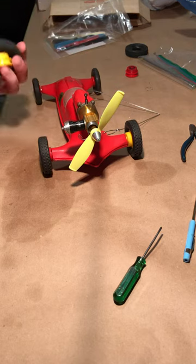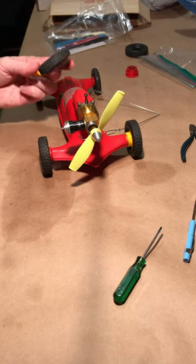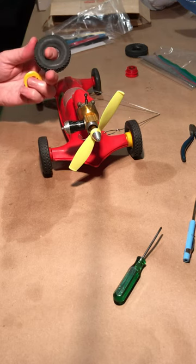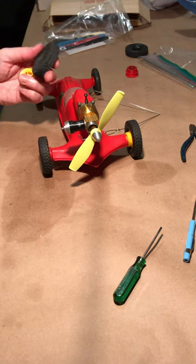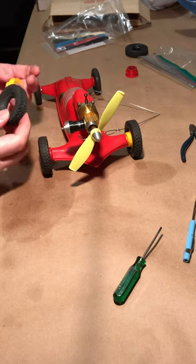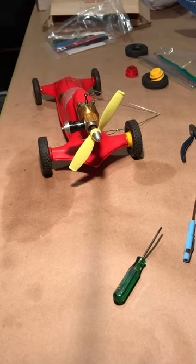Getting the tire onto the wheel was done by heating the tire in hot water from the tap. I took it into the bathroom, put the wheel and the tire in hot water, left it running, filled the basin and put a little soap in. Got the tire very warm with tap water and eventually with just brute force you can force the tire onto the wheel. It's not easy, but basically you just need to warm the tire up — that seems to be the key.